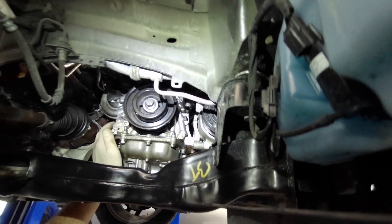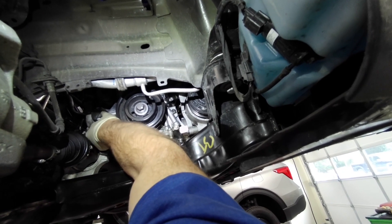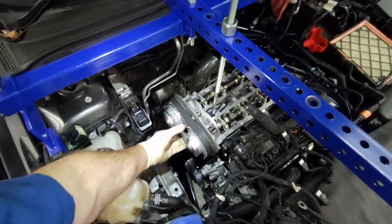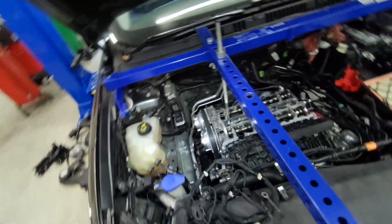We are all lined up and tightened up. Next thing is to pull out the crankshaft locking tool, the 303-748, and this thing is set up and ready for reassembly. Put everything back together, clear the codes, fire it up. The tools go in nice and easy — they're not bound up. There you go, that's how you set it up. Appreciate it, thanks for watching, see you in the next video.